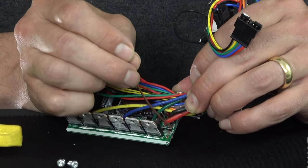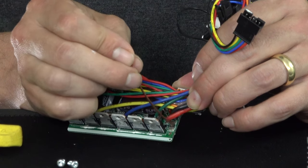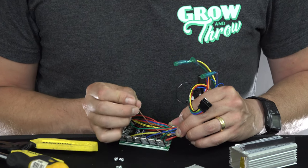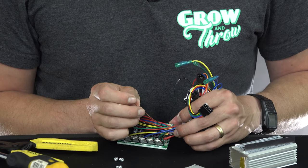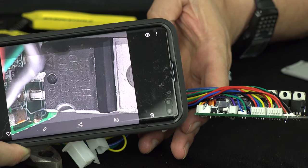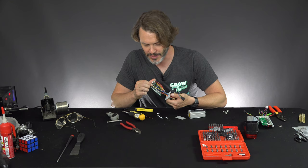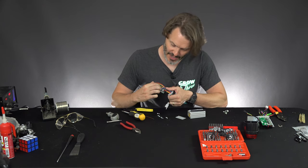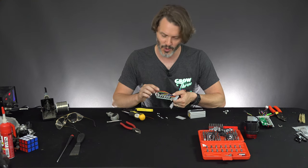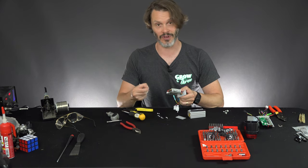This little resistor right here is our shunt resistor. What I'm going to do is bridge some uncoated copper wire over the top of it, and that is going to reduce the resistance effectively — probably cutting it to maybe a fourth or a sixth. The phone camera actually did a pretty good job of looking at it. A quick search of the internet did not reveal what these MOSFETs were; I would hope there was better etching to read them properly. But it runs, I didn't notice anything running hot, so I'm going to just stop there and find out how good the MOSFETs are the easy way — by overheating them with our shunt mod.